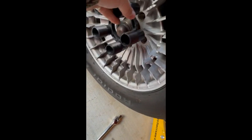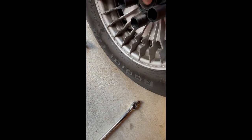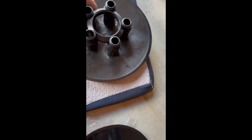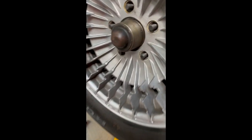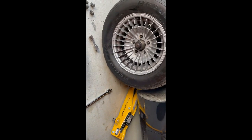But I highly recommend, just for your own car, taking them out and not just putting them on as is, but taking them out and then finding the depth by putting your hubcap on it and then tightening there, which I did with this one. In shipping these get pushed around, but you want it exactly to fit your car, and you want to be able to tighten your lugs with these seated so you're not pulling on them and cracking them at the end of the day.